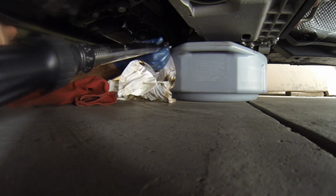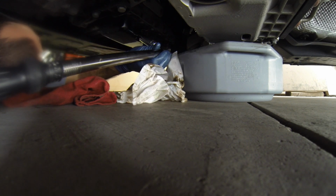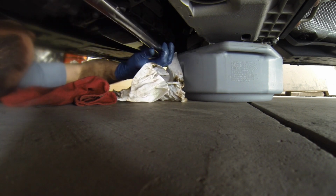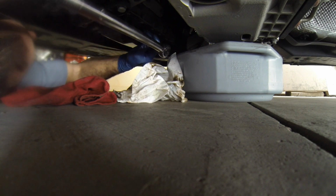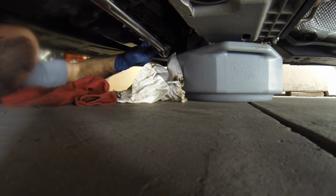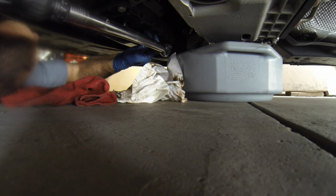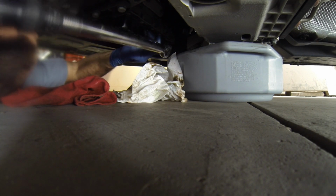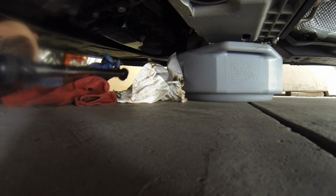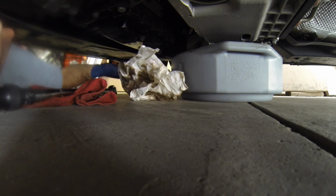And I know it's been pretty anal, as a lot of people just choose to use their sense of hand torque to do this, but I'm just going to give it a little. There we go. 22 foot-pounds. Alright, so that should be leak-free. We'll check it again later though once we get it warmed up.